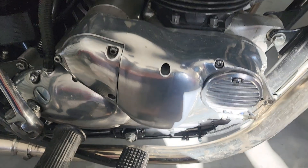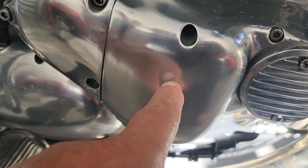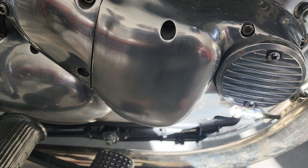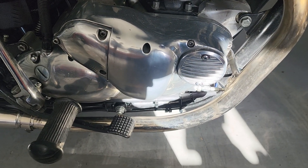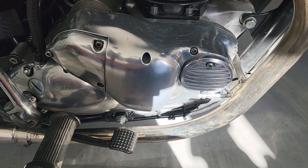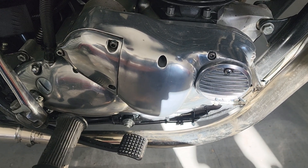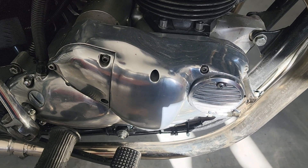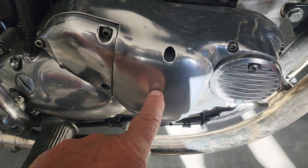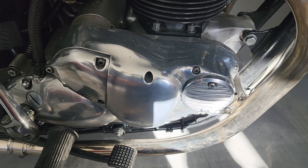That oil supply is protected by the oil seal on the end of your crankshaft — if there's a problem with that, everything else in your engine is affected. What I've seen so many people do, because that oil seal is leaking, is put a bigger pump on which pumps more and more oil rather than sealing it. Pumping more oil is not going to solve the problem. You don't need to spend hundreds of dollars on bigger pumps — just change that oil seal. It's three dollars. It's madness to put a bigger pump on; the pump that's on it is fine.